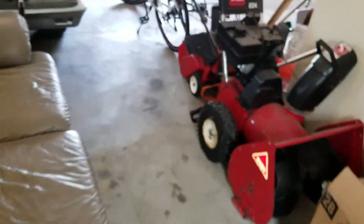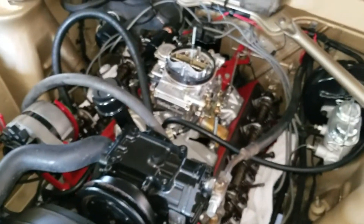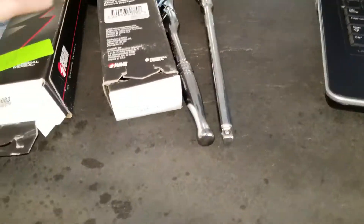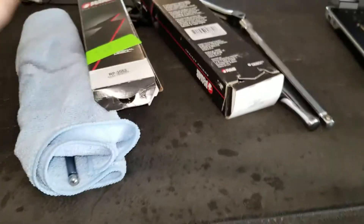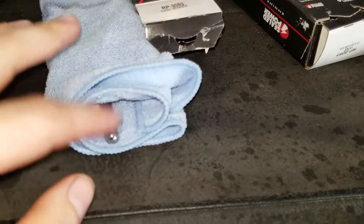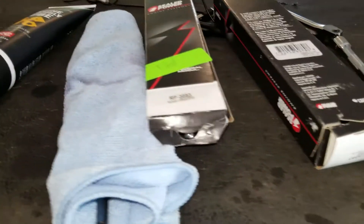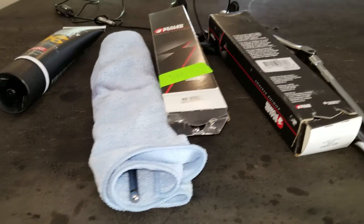I didn't get a video of the noise because I was worried about it being lifters as well, and if it's lifters I don't want to screw up that flat tappet cam — blanks are tough to find and I do have two currently. So I got all new Sealed Power push rods — the last ones were Melling. I compared them and they're basically identical; I'm willing to bet they're made in the same place, just stamped with different part numbers. I also grabbed some assembly lube to put on the ends, just because there was oil on there before and I want to make sure I get lube down into the hydraulic lifters.